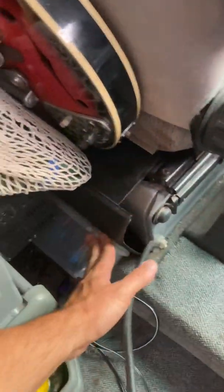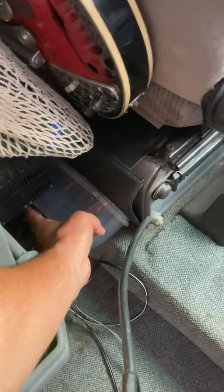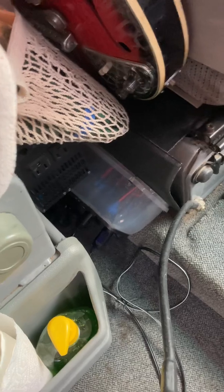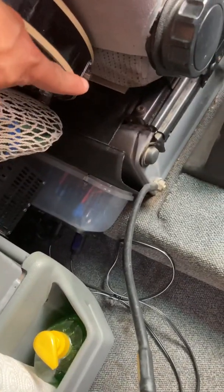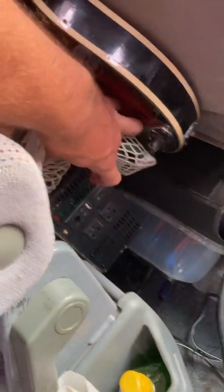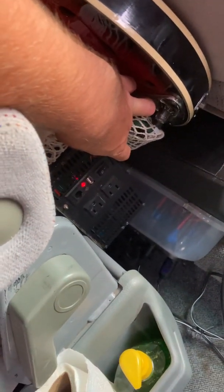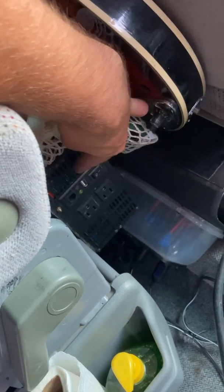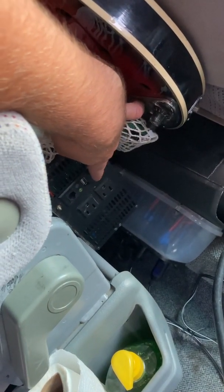Hard to see. Back here, there's a bunch of plugs. They're 12-volt plugs with a switch. There's also some USB plugs back there. It all runs off the accessory battery, which is underneath the driver's seat. There's also a 1,000-watt pure sine Renogy inverter. That's hooked up to that accessory battery, and the solar panels are hooked up to the accessory battery. I'll take you around to the driver's side to show you that.